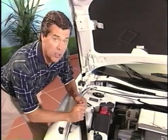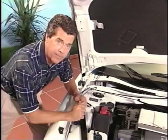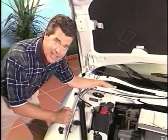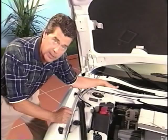It's barely noticeable, but if you run a hose here, you may actually see the water run under the housing. You will definitely see it come inside. To repair this condition, Brian explained that he removed the housing and cleaned away all the existing sealer. He then applied a bead of liquid rubber under the lip of the housing where it contacts the cowl. Next, he carefully replaced the housing in the opening and let everything dry. Finally, wearing a rubber glove, he applied another coat of liquid rubber around the inside of the housing lip to complete the seal.